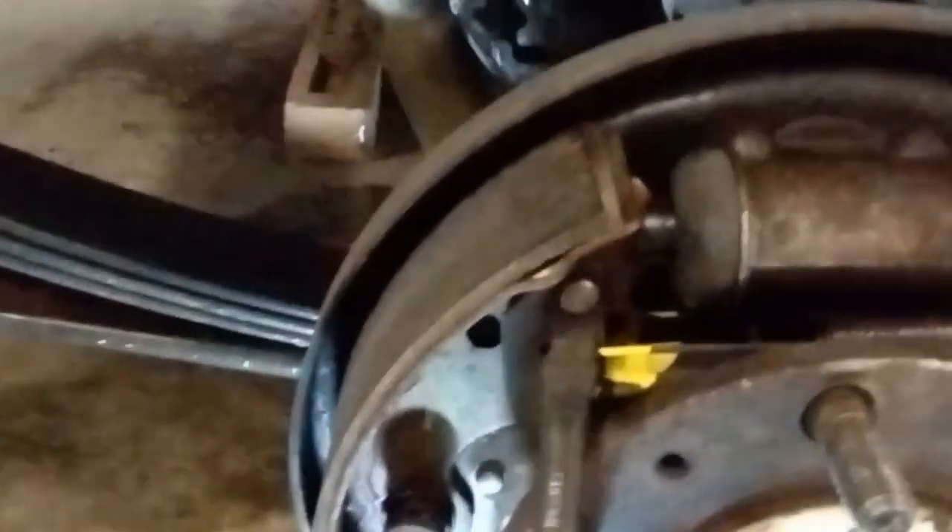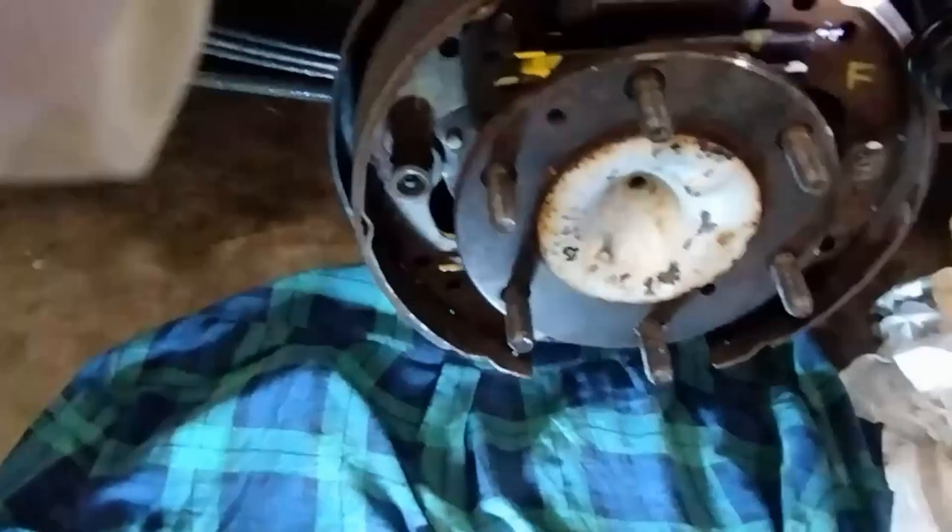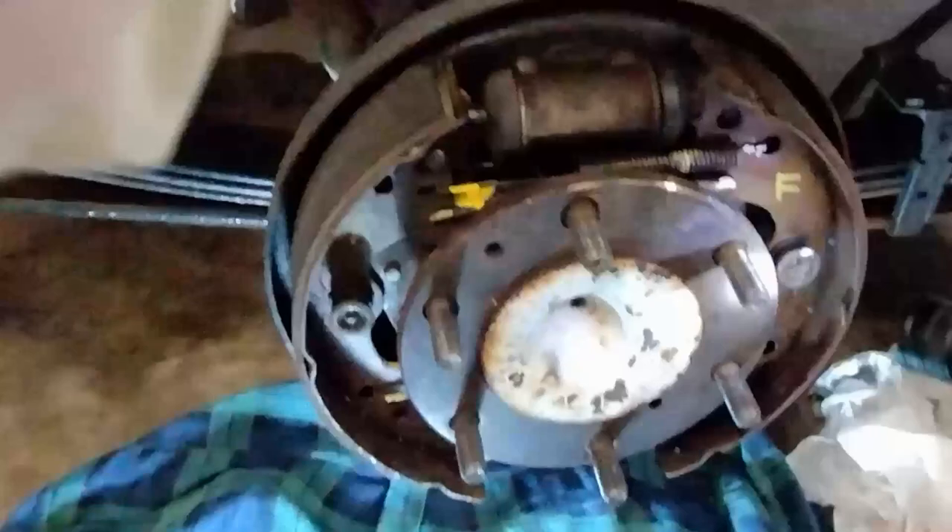This cam going down here has an arm that goes under that wheel there, and that arm goes against the wheel and rotates it, tightening the shoes onto the drum.